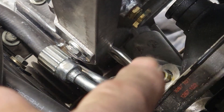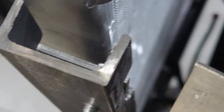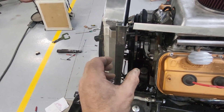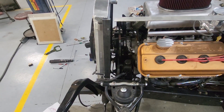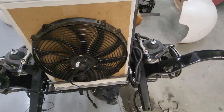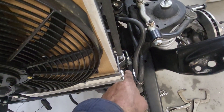Right there with that ramp on it — I loosen those three bolts, this goes in from the engine side, but because it bolts from the inside out I can loosen those bolts, clock it, and pull the whole thing out. So it is still serviceable. I was sweating on that side — I did that one second specifically to concentrate on how I'm going to get that bracket in, but it does come in and out.